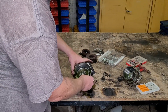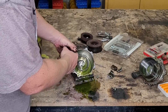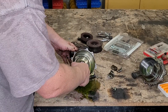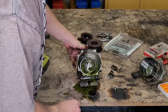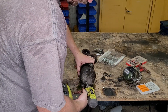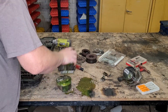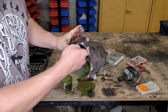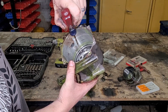Now let's look over here on the other end. The hole for our suction port, which is the larger one, is here. And our high-pressure port is right here in the middle of the scroll. So it pushes the fluid — it gyrates in such a way that it squeezes the fluid along the spiral path. That is amazing. We can pull this out because I saw bolts on the back here. Here's our case for the compressor. Our back port comes through in the very back here — you can barely see it, but there's a hole — and that's your high-pressure port. So it goes along that scroll and it goes through there.